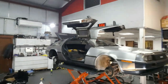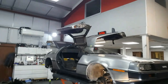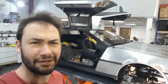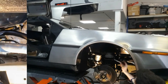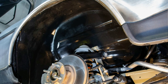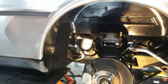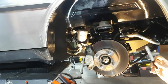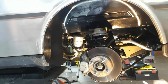We've been hard at work for the last hour or so getting this wheel arch looking good on this DeLorean. Ian has applied stone chip guard to the wishbones and the anti-roll bar. All the dirt up in the arches has come off and everything's been dressed. There was some black spray paint in here previously, but we're not going to get that off with this process. All the chassis and aluminium is nice and clean, all the grot cleared from inside the little crevices. We haven't touched the brake discs — you could take the rust off the disc edge and paint up the hub to make it look shiny and new, but the owner just wants to keep it original.